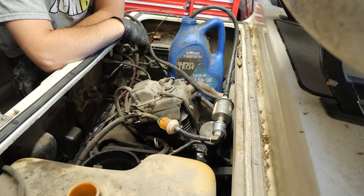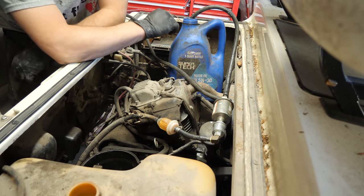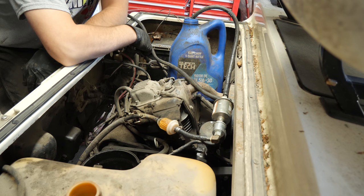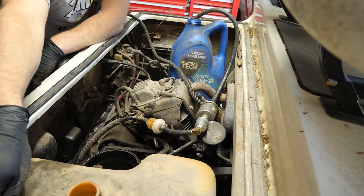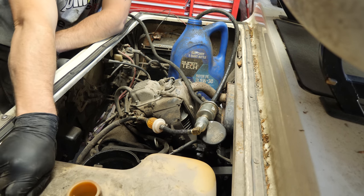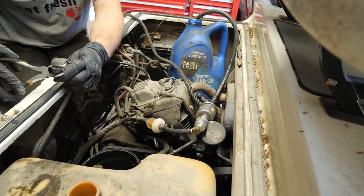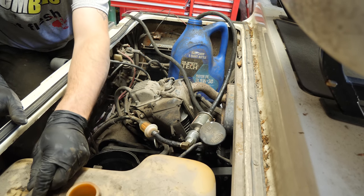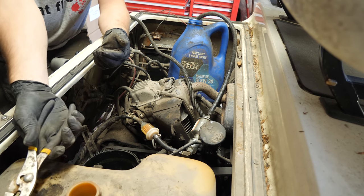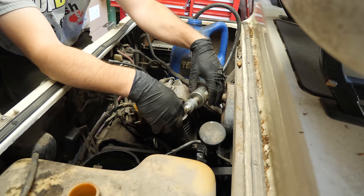No more air bubbles in the filter. We're just going to drain this tank completely because I could put this all back together and not get all the water out, so I'd rather completely drain the tank. We'll wipe it out with my wiping stick. And then I think what we'll do is fill this tank back up with some ethanol-free fuel. As long as the fuel line isn't leaking and it isn't falling apart, it's still good. I believe in doing it the right way, and I feel this is the right way.